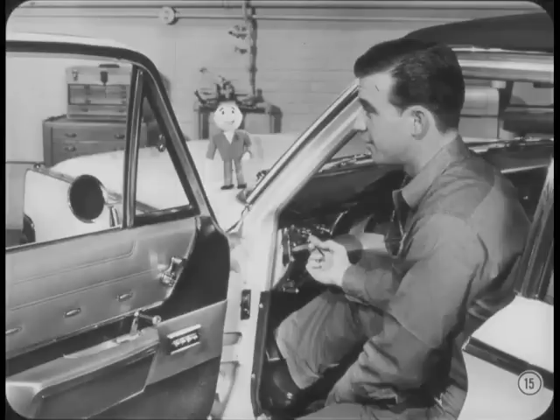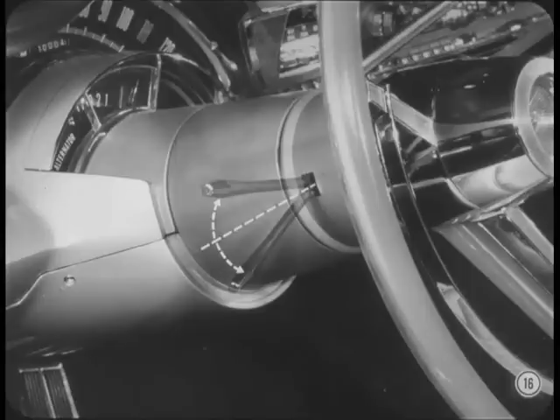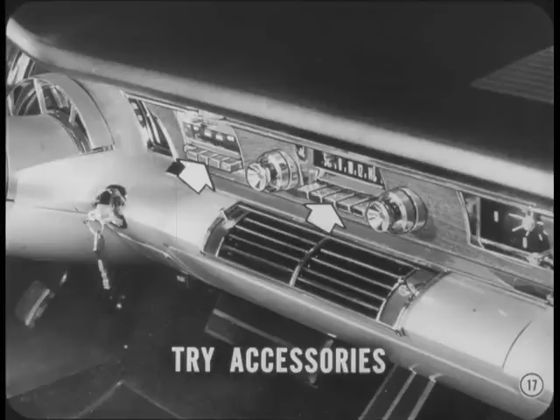I think Hank has a couple more tips for you. If you suspect a flasher unit, try it in both turn positions. If it works in one direction but not in the other, the flasher's okay. The trouble is either a bad bulb, a bad ground, or a loose connection. When the turn signals don't work on either side, see if the heater and radio are operative. They also get their power from the accessory lead of the ignition switch. If they're okay, install a new flasher unit.